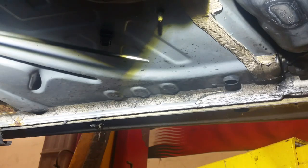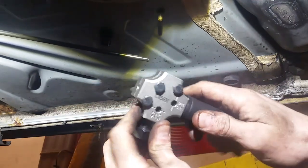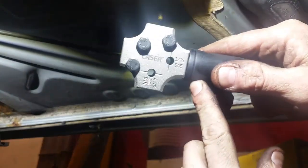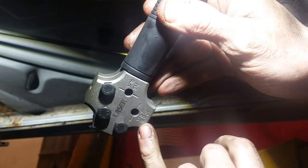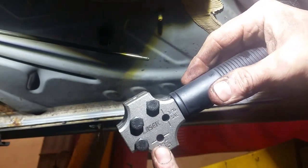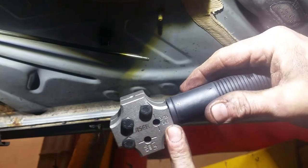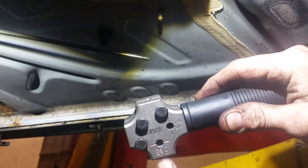So this is handheld. There's a handheld from Laser Tools, which is what I use now. This particular one, hopefully it'll focus there, has these two settings here: 4.75mm DIN and 3/16 SAE. Now, this pipe is 3/16, which is equivalent to 4.75. It's actually 4.76. However, DIN is like a European standard, and SAE, Society of Automotive Engineers, is American. These will do these two different flares.